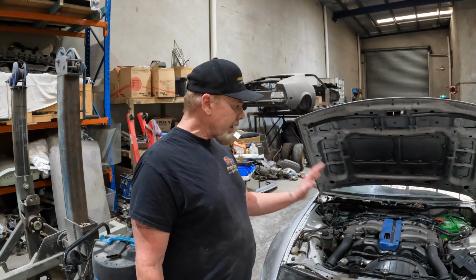I've got to grind a bit of old work off here. Who knows what that was, but we're going to grind it all off and clean it all up. I'm going to make a plate that slips under this one and then comes to about here on the steel dowel, and then I'll be able to do what I did on the top side, which is weld the two plates into the steel dowel, so basically mold it all into one and then finish it off. I'm also going to put a couple of little fish plates in here and here.